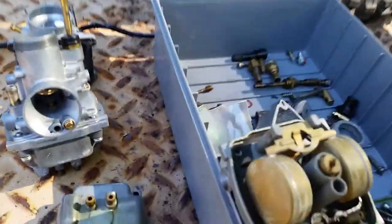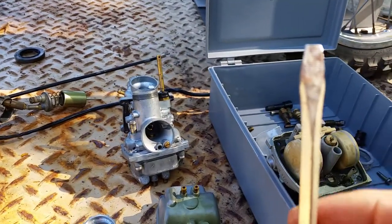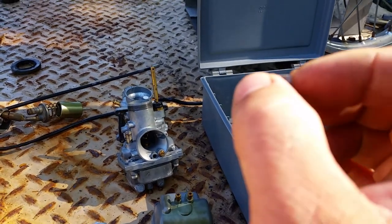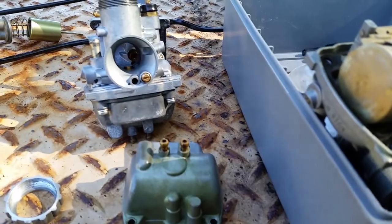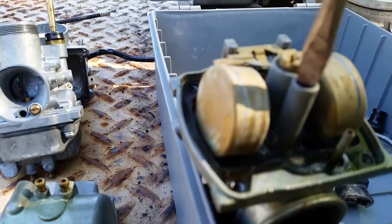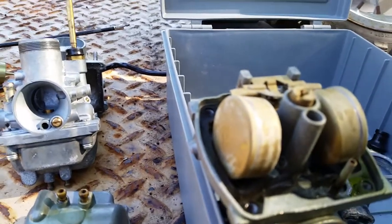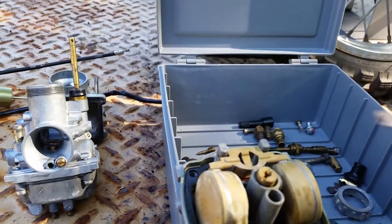Typical guy. Okay, so these Craftsman screwdrivers, see how it's wide, it's narrow down here, and it goes up to a nice wide part right here, and then narrows out. This is an incorrect screwdriver to try to force into that carburetor. If you do get it in there, you're going to strip the sides of it out and probably ruin the threads. Okay, so this is an incorrect screwdriver.